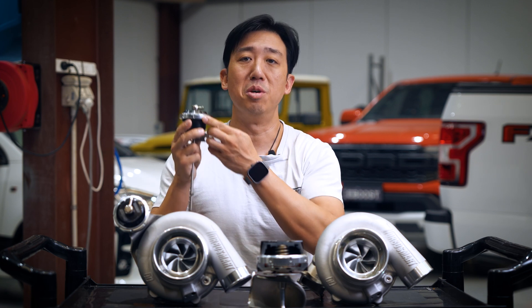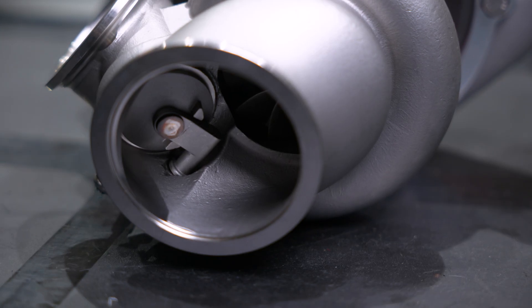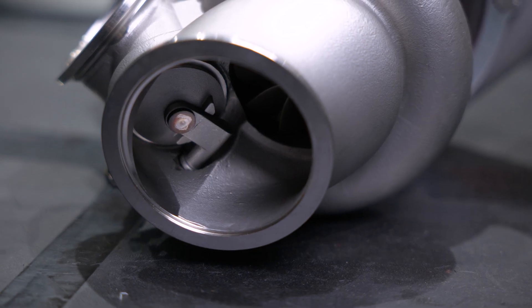If you're looking to upgrade your standard actuator, we have a range of direct fit and universal actuators for your OEM turbo. These have a motorsport grade design and give you the flexibility of interchangeable springs and plumbing options. There are a few drawbacks though. Because they're located inside the turbine housing, the size of the valve is a big limiting factor. If the valve cannot bypass enough exhaust gas to control the compressor speed, boost creep can enter the chat. It doesn't matter how much you open that flap — if it simply cannot flow enough, more will make its way into the turbine and that will lead to higher than desired boost pressures.